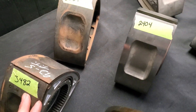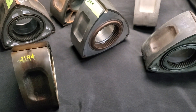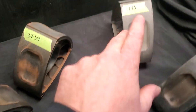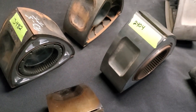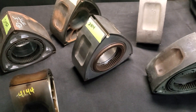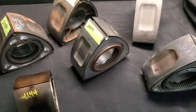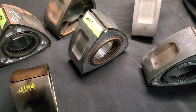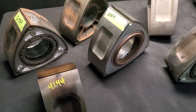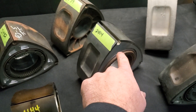I thought this was a good opportunity — I wrote down the weights and just gave us a little bit of a picture of the trajectory of what this project had: the idea of being able to cut rotor weight in half, or even more so, depending on how you applied the idea, or at least shaving a quarter to a third out of your rotating mass. If you think about that, that's never really been done outside of drag racing in rotary motorsports. There are a few drag teams that have successfully run aluminum rotors, but they're solid rotors — they don't have the internal oil passages and cooling that a rotary needs for long-term usage. To my knowledge, nobody's had success with any lightened or super-light style custom-made rotors or face-cut rotors.